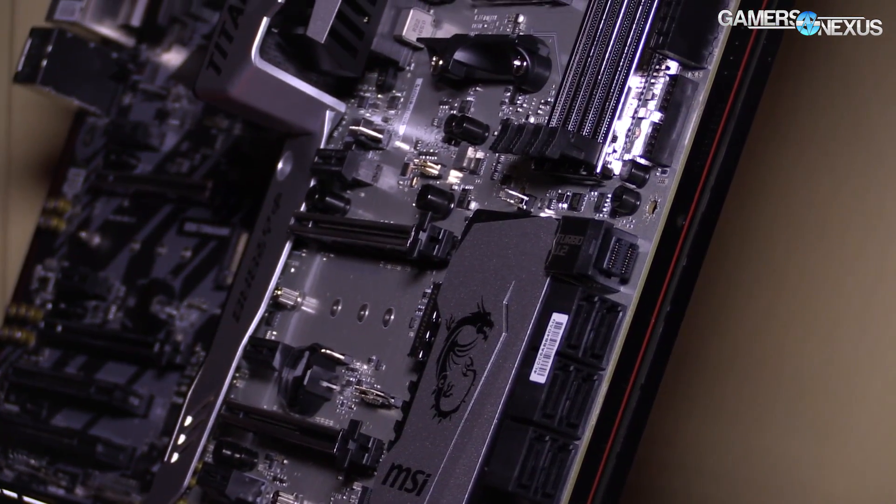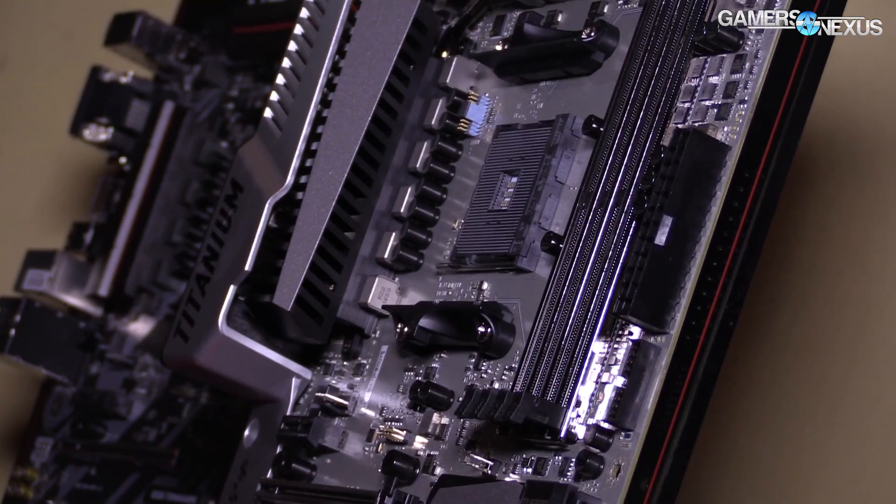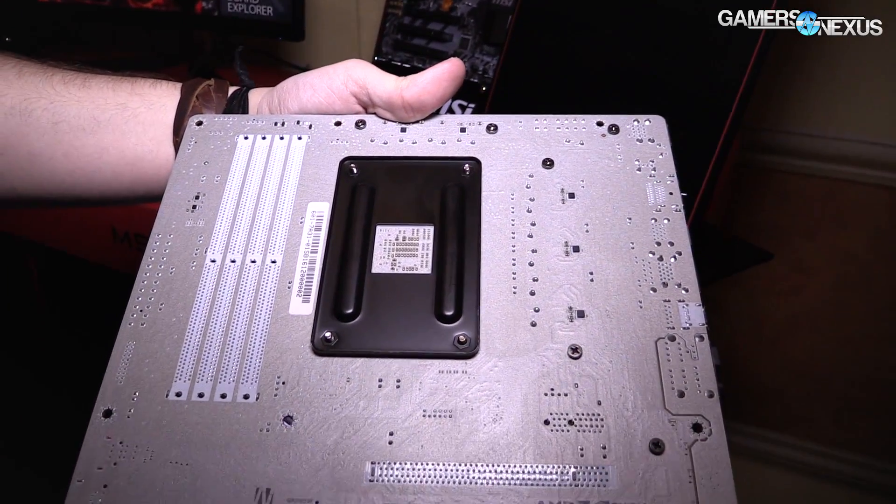Not only is PCI on there, but there's also a combo port where you can hook up legacy printers if desired. In terms of things relevant for gaming, it's really just a straightforward motherboard — looks like it's ideal with one GPU, and the muxing was a bit different versus the Titanium, as you'd expect. VRM is a lot simpler. It does have reinforced slots, and notably, motherboard vendors are now putting steel armor plating on PCIe and memory slots. On PCIe, it makes some sense for SI builds, though more likely it prevents users from ripping out PCIe slots. On the memory slots, it's more about extra grounding points than physical reinforcement.